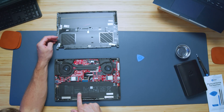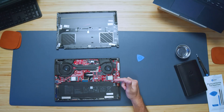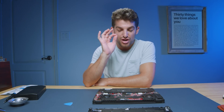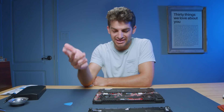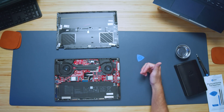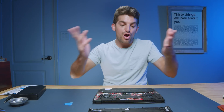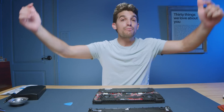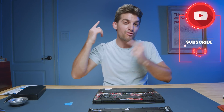Flipping the laptop over to check the upgrade path on the Flow X13 — pulling off the bottom cover reveals a 75-watt-hour battery, and you can upgrade the Wi-Fi card as well. There is a swappable SSD, though it is a smaller form factor, so check your owner's manual to confirm the correct size — I did a whole video on choosing the correct SSD for your laptop. Unfortunately, the RAM is soldered, so it's not upgradable on the X13. That's one big advantage of choosing the G14 over the X13 if you want more RAM, which is very important for video editing, Photoshop, 3D modeling, or heavy multitasking. Links in the description if you're ready to make a purchase — I'll see you in the next one.